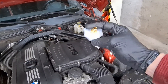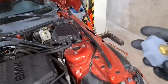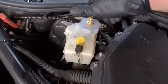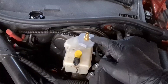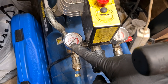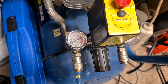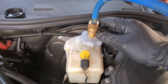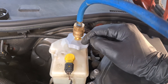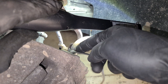Another way is to apply air pressure to the brake fluid reservoir and then open the bleeding valves on the calipers and let the air out — not with a vacuum but with air pressure. The cap fits a standard one-quarter inch thread and an air adapter, so I remove the cap, screw in the adapter, and connect the hose from the air compressor. I'm going to apply one bar of pressure on my regulator, then open the bleeding nipple and look for bubbles.